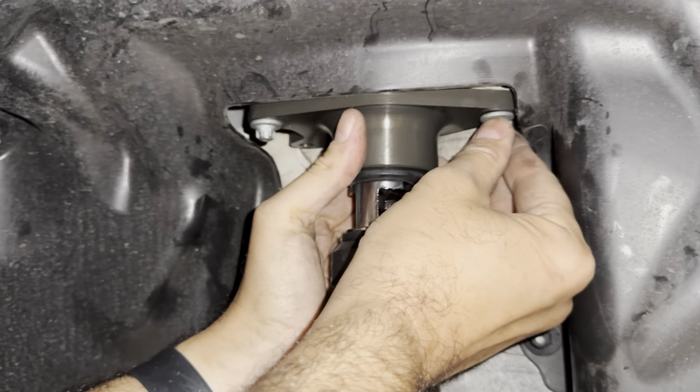Going to do these e-torx now, so they are just 28 newton meters, 21 pound foot if need be that way. I probably already surpassed that with my electric ratchet, but let's see here. Yep, already done, gone past. When we undid them, they're not particularly torqued in. Yeah, they're already in, so they're done. That's the back corner done. The other corner is the same deal, just backhanded. So we're going to get the measurements off of this again and apply it to our parts and get them on the other side. It should take probably half as long.